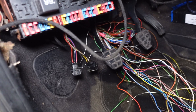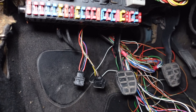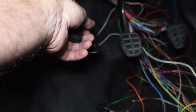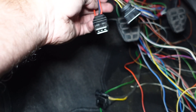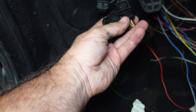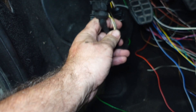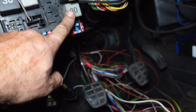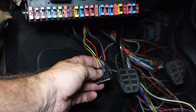Hopefully you can see - it plugs right there, sits really neatly, and runs along and then under the servo. This is the mess of wires I've got inside. As I showed in the earlier videos, I've put these two plugs into the fuse box - the ones that go to the ECU and from the ECU to the fuse box. I've got it all coded so it's literally plug and play, which makes life a lot easier. First thing I'm going to do is put the fuel pump relay in.